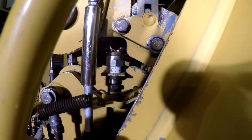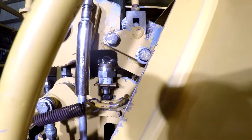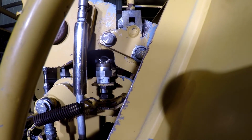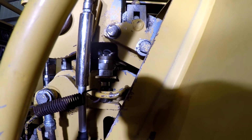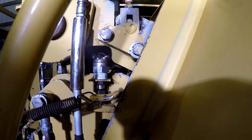But I think there's something going on with this new switch, based off of what I'm seeing. That's my diagnosis this time, because as I say, if I can jump a screwdriver across those back terminals and it works, it's working. So it's like it's passing enough voltage through that the solenoid will sometimes release, and once it's released,